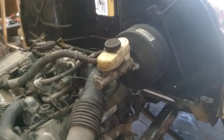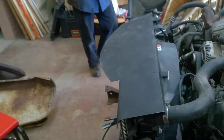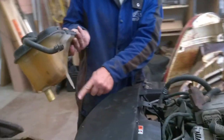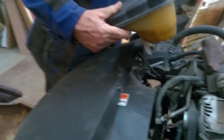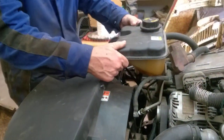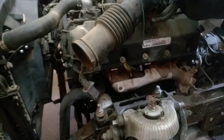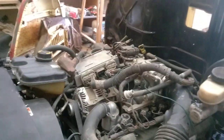This is the brake master cylinder, and we're looking at brake lines today. Kyle fabbed up a cover to clean that up in the front. We've got the radiator overflow again from the Crown Vic, which has a little finger on it, and he fabbed up a little bracket to hold that. So this is going to be the Crown Vic International, and hopefully it rides like one too.